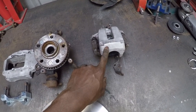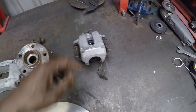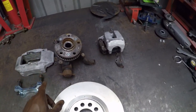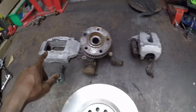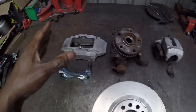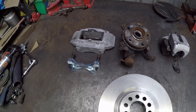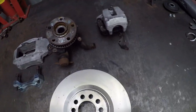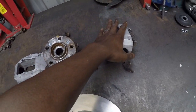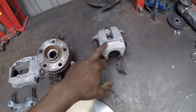Then we have a set of 256 calipers off a Golf VR6 4Motion - these are the rear ones, so they've got the attachments for the handbrake. The reason I'm going twin caliper is because it's a front hub setup, so it's not set up for a rear caliper, and the Porsche calipers don't have any handbrake functionality. So I'm using the 4Motion rear calipers for the hydraulic braking and the mechanical handbrake.